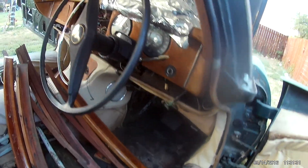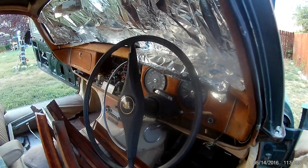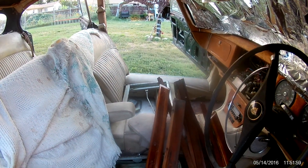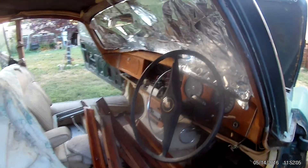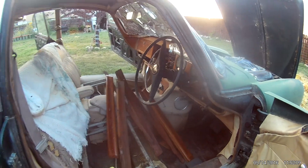This was driving, but there is a DG250 transmission in it and it leaks horribly. There is also low compression in number two cylinder. So if you were to buy this, you'd want to put a new transmission in it like a 700R4 and do an engine rebuild, which is normal.